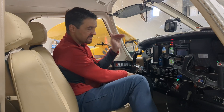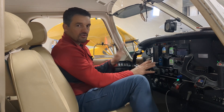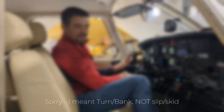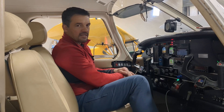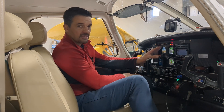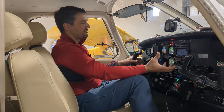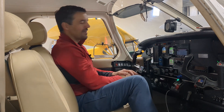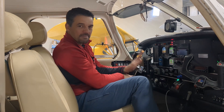You still need to have a backup airspeed and altimeter, but in regard to other instruments, you need to have either an attitude indicator or a slip skid. My slip skid bearings were going out and needed an overhaul, and I wanted to get rid of my attitude indicator. That added complexity because my attitude indicator was driving my legacy autopilot, so I had to get an EA-100 from Aspen. Ultimately, the best solution for me was the uAvionics AV-30C.